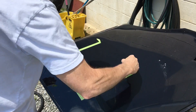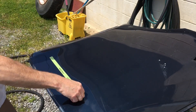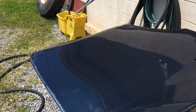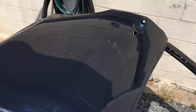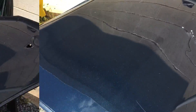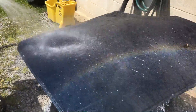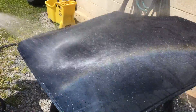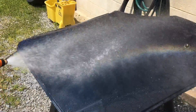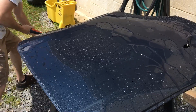Let's drag this panel outside and remove the tape. I like to take a look in direct sunlight — does it make the panel or your vehicle look darker, richer? Give it depth? Bring out that gorgeous metallic or flake color? And indeed it does. Also remember, I did scuff up the panel, so it does have some minor filling capabilities as well. This coating is hydrophobic opposed to hydrophilic, so it does reject water. It'll give you the high contact angle and beading, and you can easily tell where the protection is on this panel.